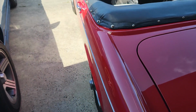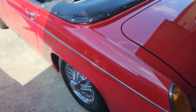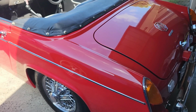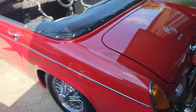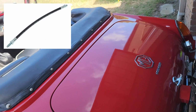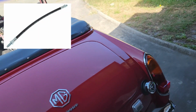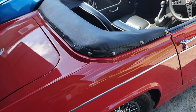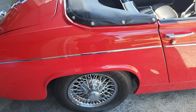So a few things that I've heard online is that there might be water in the system or air bubbles, which I'm going to do that anyway. But eventually there is the elastic pipe at the rear brakes, I'll show you in a minute, that might be failing, and it works as a check valve and it doesn't relieve the pressure once you apply the brakes.